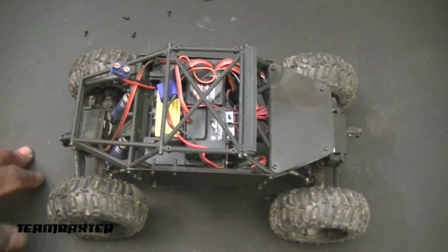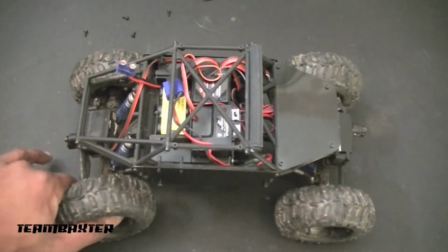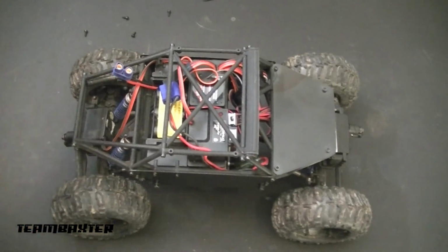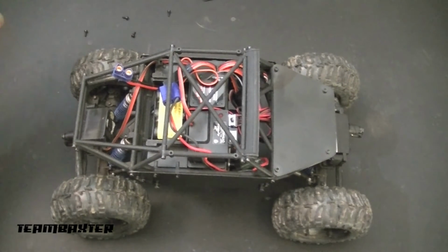There are multiple ways to complicate this and get your dig set up and all that, but this is just, as I said before, a simple four-wheel steering setup. It's highly beneficial to have these back wheels moving. It's going to get you out of more than just regular steering. If you want to explore getting into independent front and rear steering, that's great. That's something I don't do at this point, because just the regular four-wheel steering is more than sufficient and much better than the original steering.